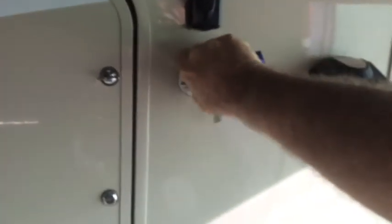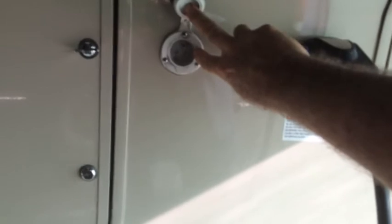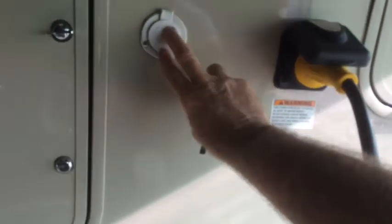Here's the receptacle I installed. Got it off Amazon, I believe. It just takes a standard plug. I also bought a 10 gauge 30 amp standard receptacle extension cord on Amazon that I use for this. The reason I used 10 wire on everything was not due to amperage requirements. I just want to try and reduce voltage drop.